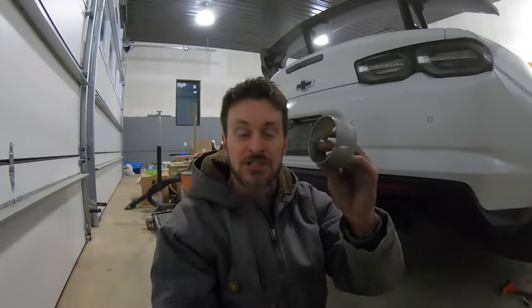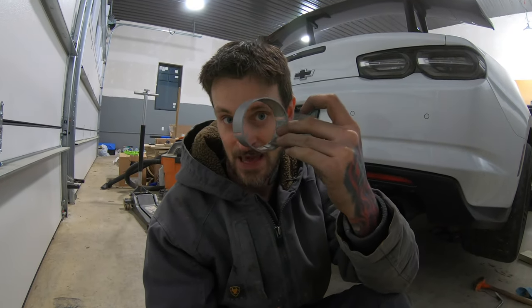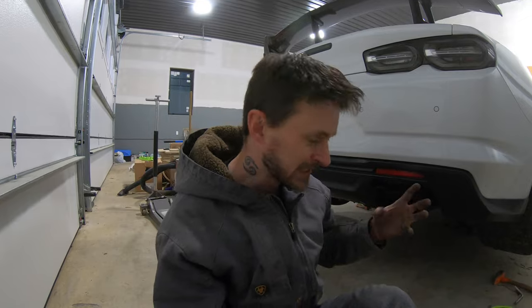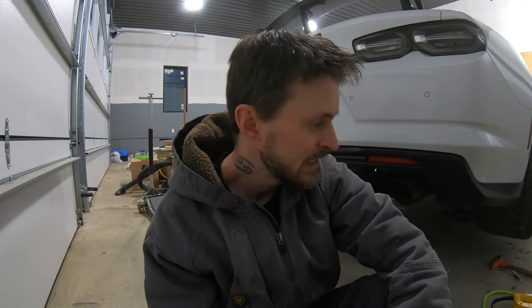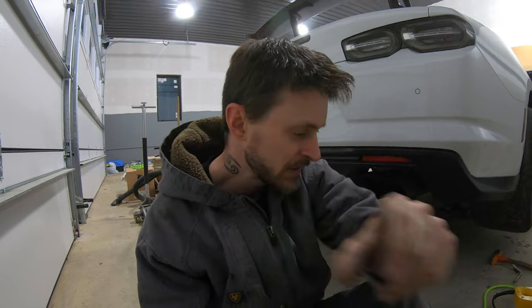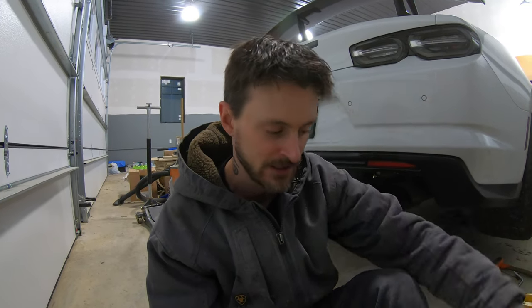So I just completely cut that piece off, and that gave me that part back, and I was able to slip over the pipe. But of course I can't really put a V-band or a clamp around that to hold it tight. What I'm probably going to end up doing is putting the clamp on, because I don't think it's slid on as much as you want it to, because they want you to slip the pipe over another pipe at least an inch and a half. Well, that's an inch and a half right there.